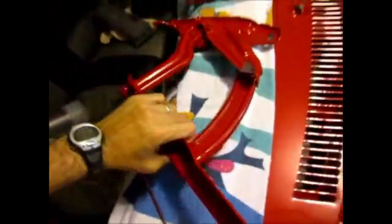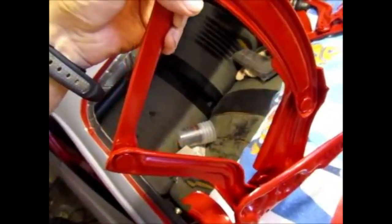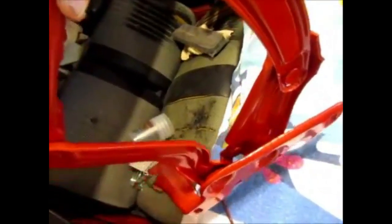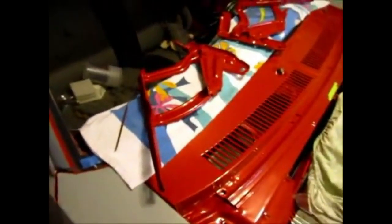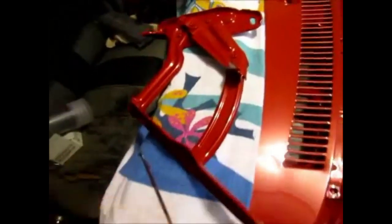Now, obviously, because it's laying down on the floor, the way I did it was, first I sprayed the backside. I always started with the backside. Then I waited to flash, closed the hinge and sprayed it again on the backside. Wait till that flashed. After it flashed, I picked it up and laid it down on the painted side. The base coat dries pretty quick, so when I laid it down, minimum damage was done to the paint. And then I repeated that.